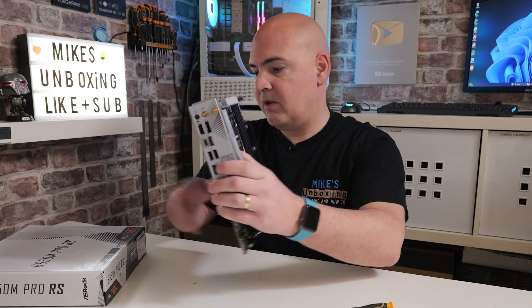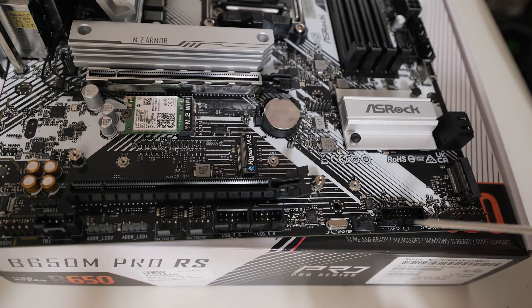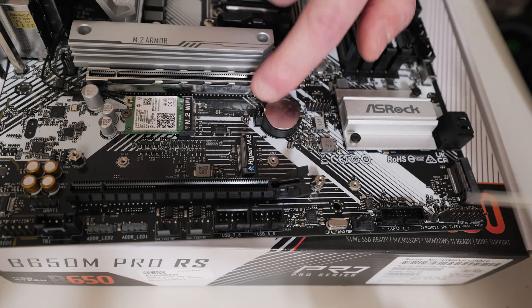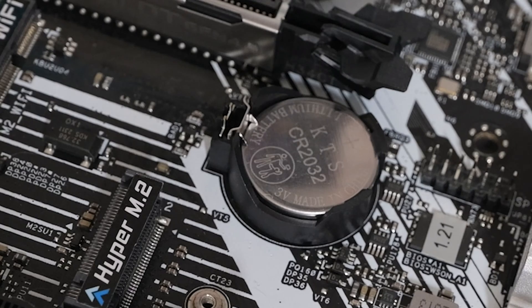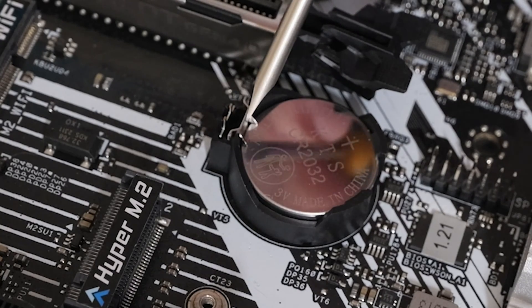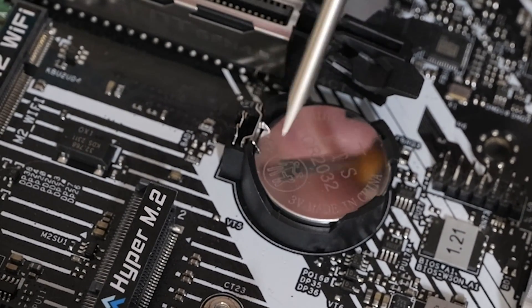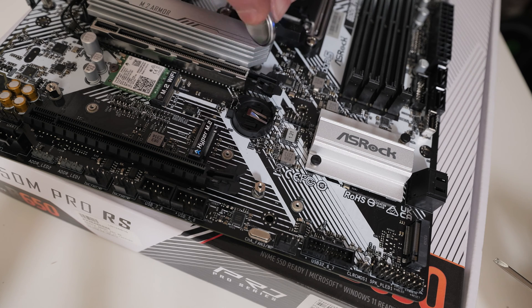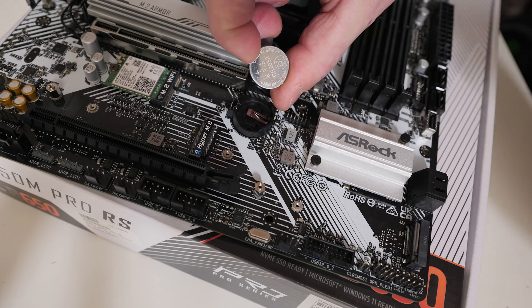So we're going to put the motherboard in a suitable position and move the camera in for a close-up view. Here is the close-up of the motherboard with all components laid out. There is our BIOS battery, which is retained by a little metal clip on the side. To remove it, get your screwdriver and very gently lever that piece of metal out of the way and the battery should pop out. Note which way it's oriented — normally you can tell because it says CR2032 on the top with the positive plus sign.